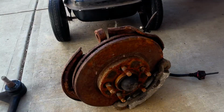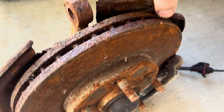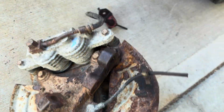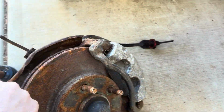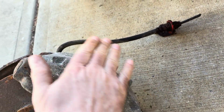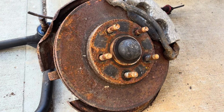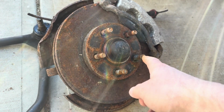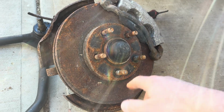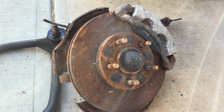What else are we doing? Here's the old, look at these beautiful junkyard parts. Whatever, I'll delete the backing plates, buff everything up nice. That's the aluminum calipers. So this is essentially an SN95 spindle setup, and it's the later one, the 96 and up, because this was off of a 2000 Mustang. So these move my wheel flange out about 318 thousandths of an inch.